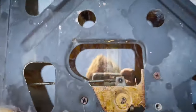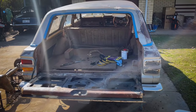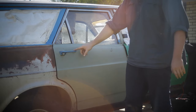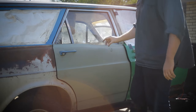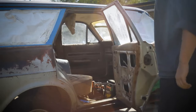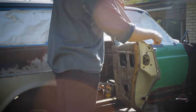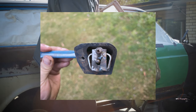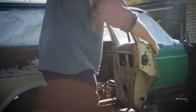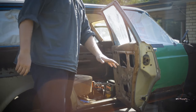Greased up the mechanisms so everything is happy - working tailgate on the Falcon. This was also interesting because this was a door skin with no mechanism at all - just a door handle. Didn't have the glass, didn't have the quarters, didn't have the strip - but it's a rust-free door which is really cool. It was the same steps: connect the lock mechanism, the latching mechanism. I had to weld a plate on the door handle because the plunger that hit the paddle on the door mechanism was missing, so I welded a plate to direct it to the right so it hits the paddle every time. Now it works really well.